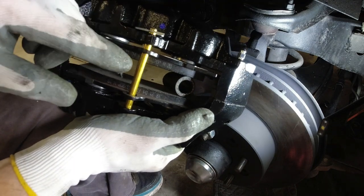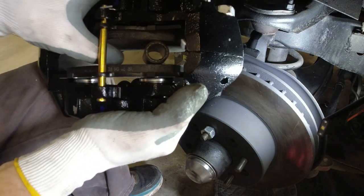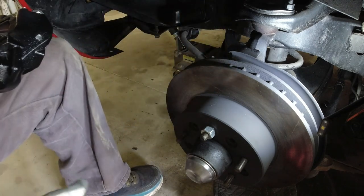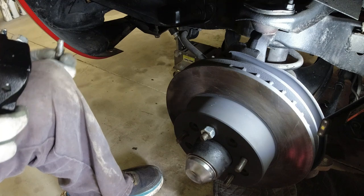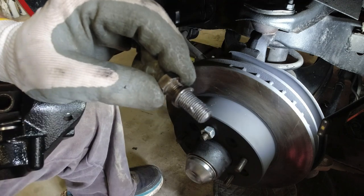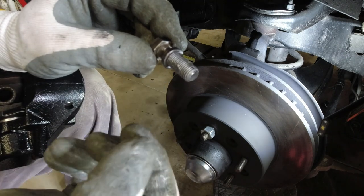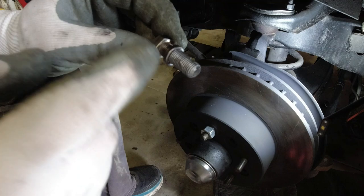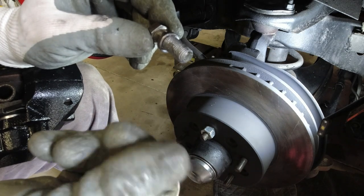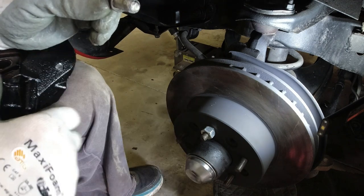The pads slip in from the top and a pin holds them in place. I put a couple pieces of heater hose in there to keep them spread apart, so when I put the caliper down on the rotor I still have room to spread them a little further — without that they'll flop together and it's a pain to get started over the rotor. On the mounting bolts, I clean the threads with a wire brush and then put a layer of never-seize on them. That stuff works really good — 50 years from now if I go to take this apart, that bolt will come out easily.